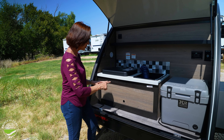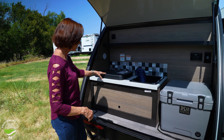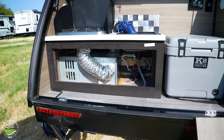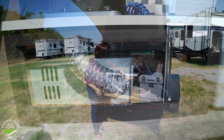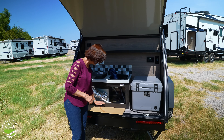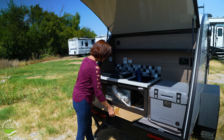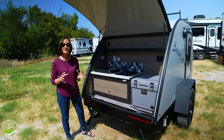This is a panel that comes off — no screws to unscrew. It's not storage; it gets you into where the wiring is, where the stove bottom is, and also into some other gear. You just lift it up and it comes right out. You can use this hose if you wanted to winterize. They have a valve right up there that you turn, and they even give you instructions right here. Turn that valve, turn on the water pump, and you can suck the antifreeze through this hose. It also gives you access to the water pump, the wiring, and the back of the furnace — everything is right there. And it is super easy to put back: just lift it up and slide it right back in the slot.